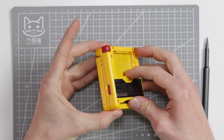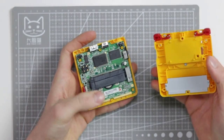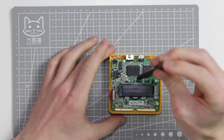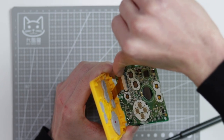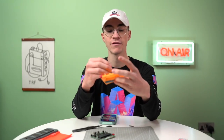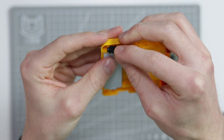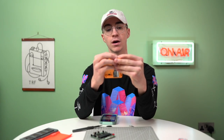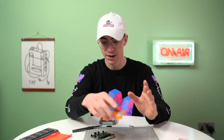The reason why the IPS one is far better is because the IPS screen is paper-thin and you've got loads of room to install the jack in the top portion of the Game Boy, which is what Mako did in his video. Since I don't have my IPS Game Boy, we're going to have to try a different way — might be impossible, we'll soon find out. Once you've undone all of the screws, wiggle off the bottom piece and remove the motherboard. Unplug the ribbon cable and set it to the side.